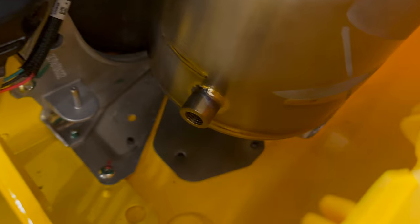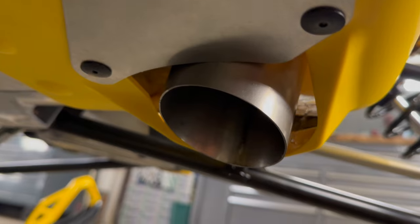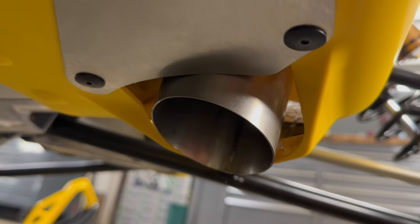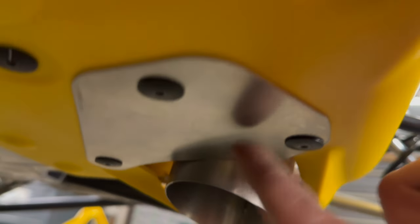And then down here on the belly pan, that aluminum heat shield, I don't know if I can get an angle on this, I'm gonna have to go from the bottom here. So you can see it just barely contacts the muffler there. So we're gonna have to trim that and take probably 1/8 to 3/16 off of this aluminum heat pan here to get clearance.